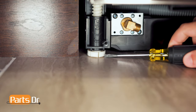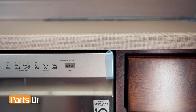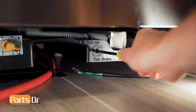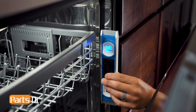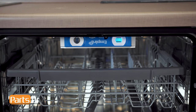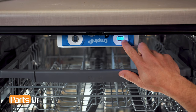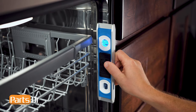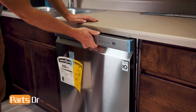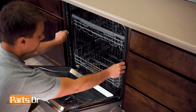Now, raise the front of the dishwasher by adjusting the legs using a flat blade screwdriver or pliers until the top is approximately one and one eighth inches away from the bottom of the counter. Then, raise the rear legs by turning the Phillips screw at the center of the base until the rear is level with the front. Check the level of the dishwasher by placing the level across the top of the tub. If needed, adjust the front legs. Then place the level along the front side of the tub to check level. If the rear legs need adjusting, continue turning the screw. With everything level, gently close the door to ensure it has clearance and doesn't hit anything. Also check that the dishwasher is positioned correctly within the opening.